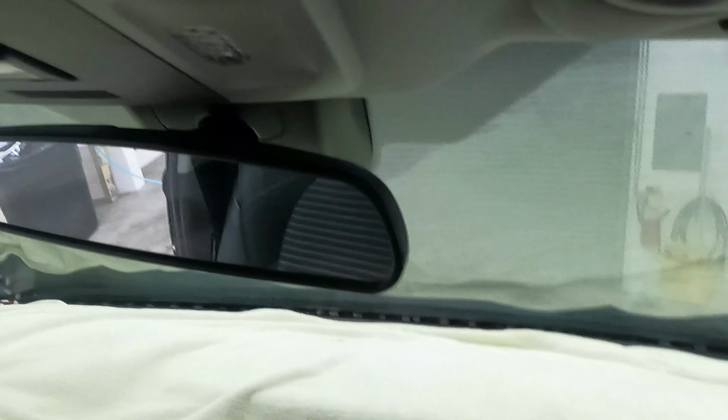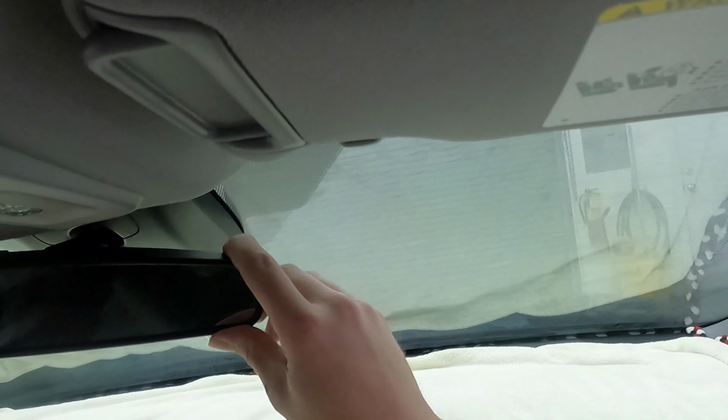All right guys, so we're inside the car now. Window tint is still obviously resting on the outside of the glass. I'm gonna go through a little bit of what to expect on the inside. So I've got my soak rope tucked down in the bottom of the shield. I've already covered the dash with a dash towel. I've got the center console as well. The mirror is not so bad because we've got this big middle box here, so we can leave the mirror on and just kind of tilt it out of our way as we apply the film. I'm in the passenger side of the vehicle. I'm right-handed, so I try to do my long reach with my left hand and control the film roll with my right hand. So we're gonna clean it.